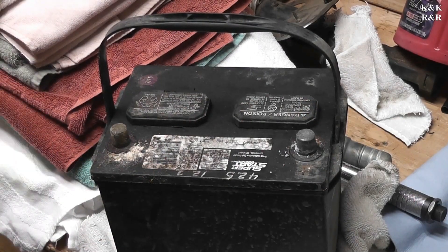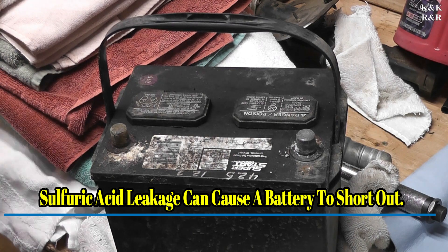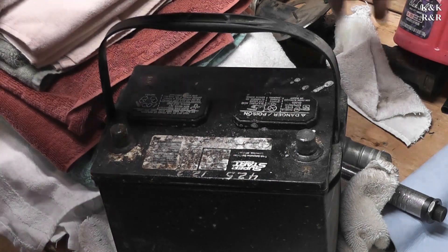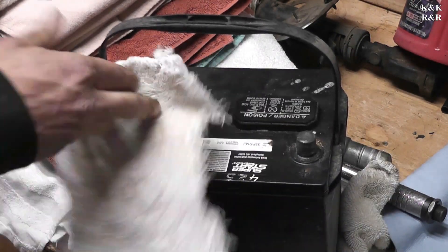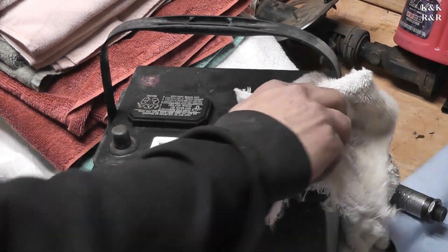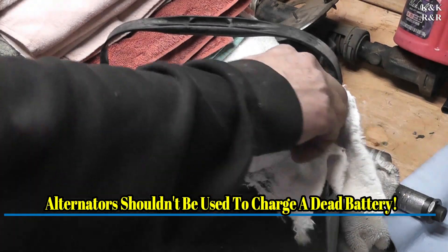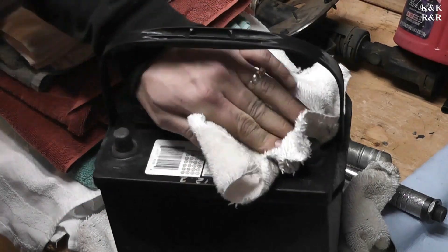Before I put this battery in the other Subaru, I've got to charge it up and get it clean. We have some leakage of battery acid, which is normal, but this battery acid can also cause the battery to die well before its time. A little baking soda, a little rag — keep it simple, that's all you need to do. No auto parts store will warranty an alternator if your battery is not at least 12.6 volts.